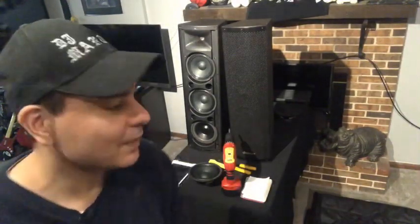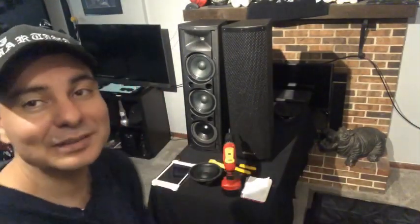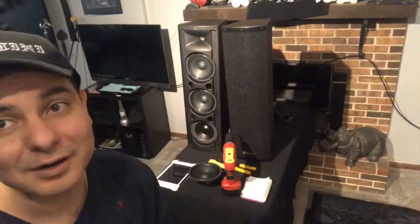You run less chance of damaging that amp if you only put one bigger speaker in there. Other than that, I really like the way they sound now — it did improve the bass, they do have bass tones now, and I'm actually pretty surprised. It just brings a smile to my face because it actually worked and it was fun to do. These are the Sonart PA system tower speakers. I do have a full review if you guys want to check that out — $190 plus another $50 for the 6.5 inch woofers, 20 ounce magnet, 8 ohms, about 90 watts RMS.